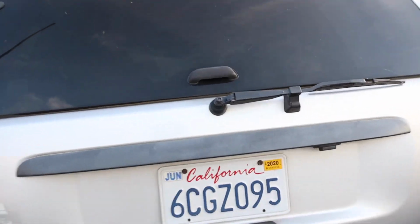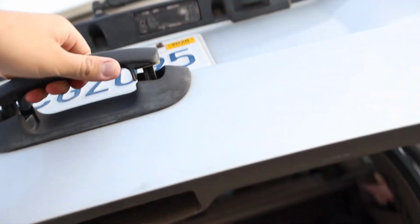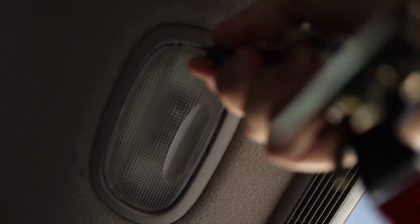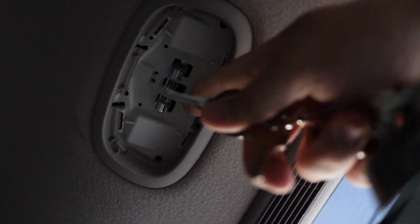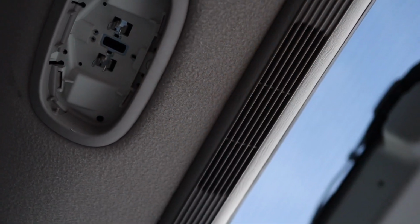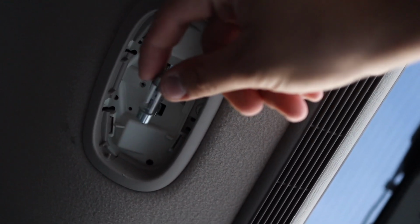So the first light we're changing is going to be the dome light in the rear. I'm just gonna go ahead and sit in here. So it's going to be that light. You could use special tools, and I'll link those down below in the description, but you don't need them. An easy way to do it, just use your Jeep key. Stick it on the side here, pop it on the other side also, and that's it. Like I said, you wanna make sure these are off so you can take them out. Just use your key, and there it is. Now the old one is out.